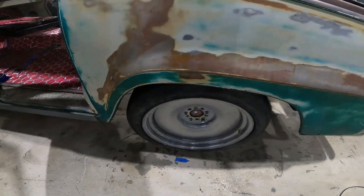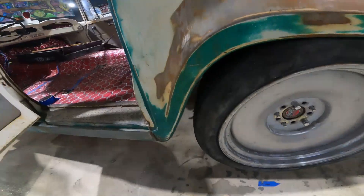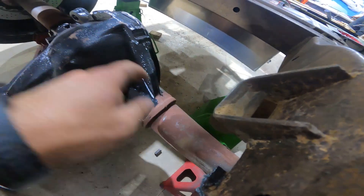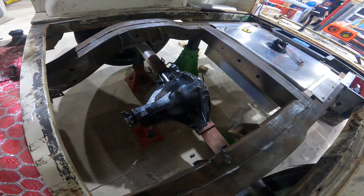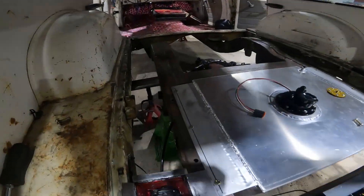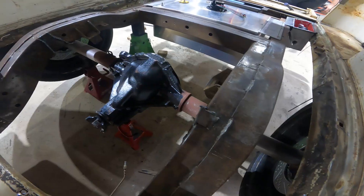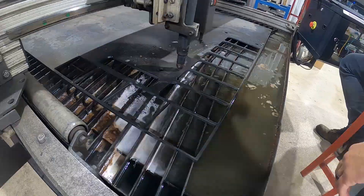We got the wheels back on to center up the wheel well — there's going to be a little rolling when this thing airs out, but the rear end is pretty much lined up where it was originally. We left the factory bump stops so we know exactly where the axle tubes were. Now we're using this four-link kit — plates that weld onto the axle tubes, standard and reverse thread heim joints, and chrome-moly tubing. The brackets go on the outside of the frame rail where the leaf springs used to be. Liam's cutting frame rail brackets on the plasma table while I cut chromoly lengths and situate the axle tube brackets.